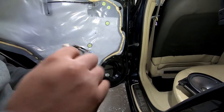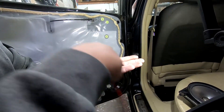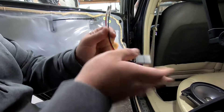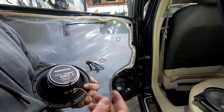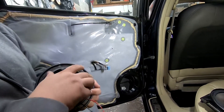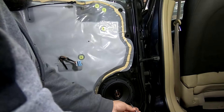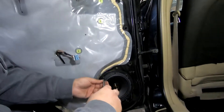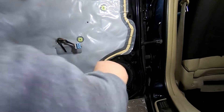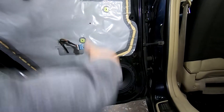Along with the spacer, you can order the speaker harness. With the spacer will also come four screws to finish mounting the speaker. With our harness we're just going to slide positive to positive — positive is always the big terminal and negative is always the small one on these speakers. Slide those on, plug it in, and mount it.